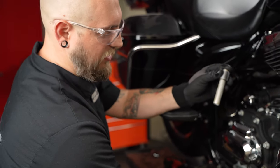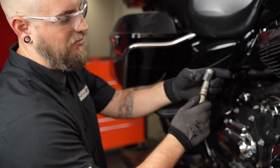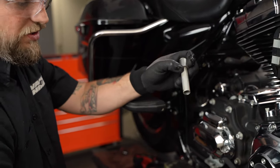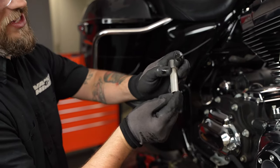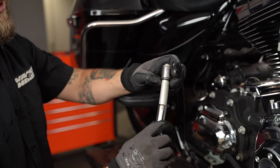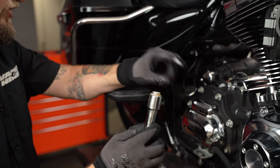So we're going to take our old push rods here, slide this collar piece down, keep the spring in place along with the washer, pull the old O-ring, grab a new O-ring from the kit, slide it on, and then put the push rod tube back together. We do that all four times.